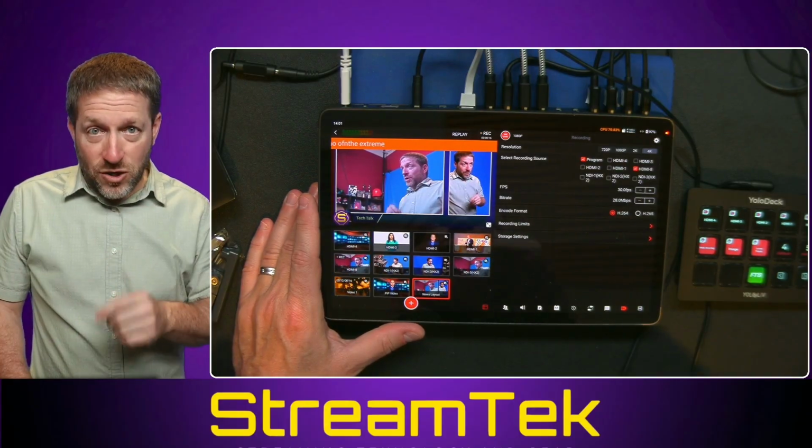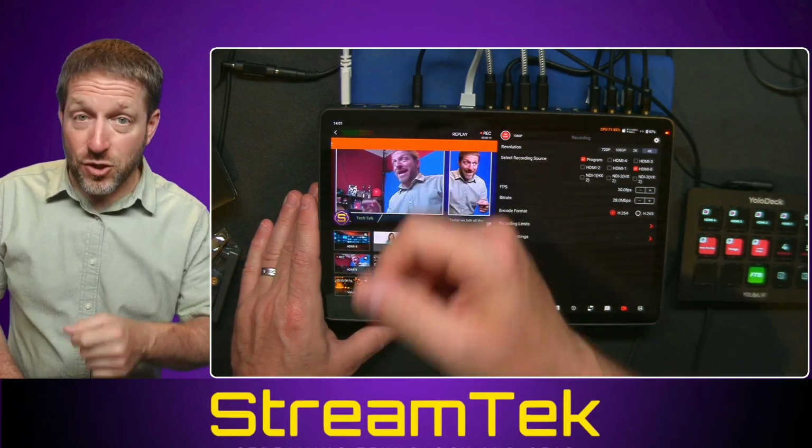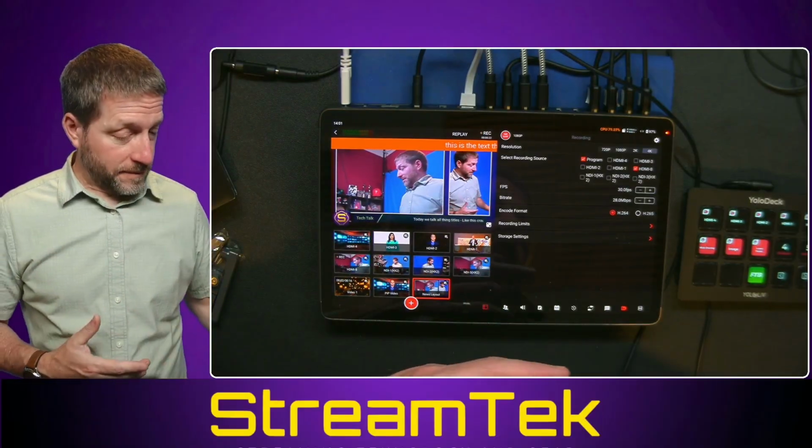Again, your recording demands are going to be based upon what your signal is. So if you are doing a talking head in front of a plain background like this, you're not really using a lot of processing power to compress this image. It's very easy to compress. If you're outdoors doing soccer in a grassy field with trees blowing in the background and the entire image is changing all the time and there's all these people moving, that's a very complex image. That's going to take a lot of work to compress. It's going to take a lot of data, and it's going to be pushing the CPU harder. So the demand on the CPU is not just cameras, but also content.